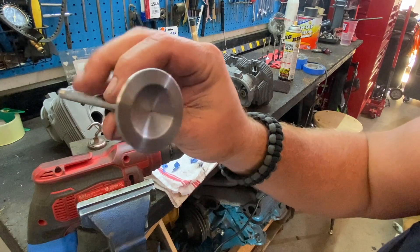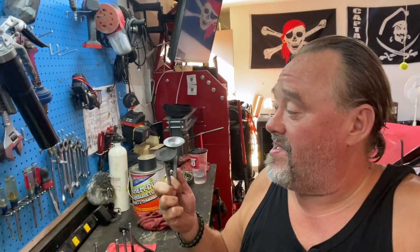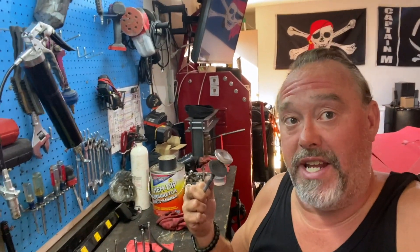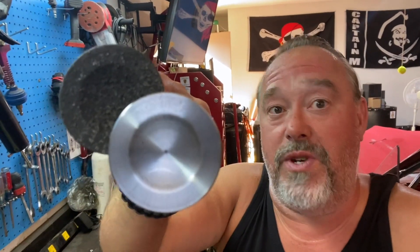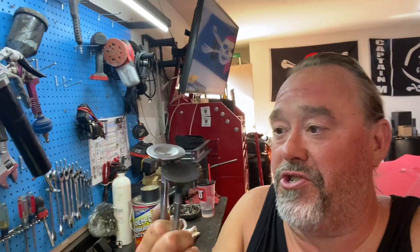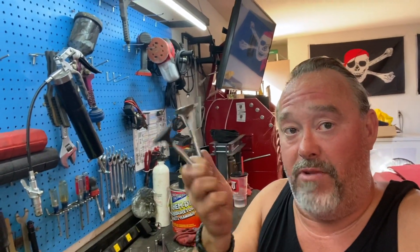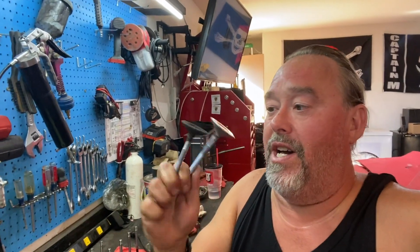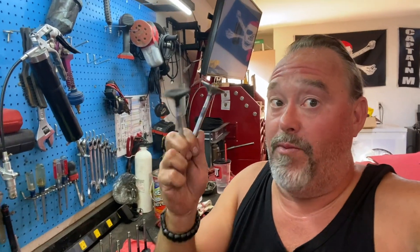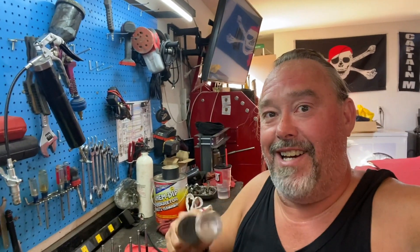That is how you clean valves on an engine. If you're rebuilding a motor and don't want to buy new valves because they're not bent or damaged, this is the way to handle it. This is how I clean the valves in my Porsche motors, and eventually I'll be working on these Pontiac motors - I've got that '67 back there and we're building a 400 for her. Check out the difference just doing this little thing. You get your scotch-brite pads, a little WD-40 or PB Blaster, spend some time, and you get your stuff looking practically brand new before putting the heads back together. If you like this video, hit that like button. If you're not a subscriber and want to see more about rebuilding Porsche motors or just rebuilding motors in your two-car garage at home, hit that subscribe button. Next we're lapping the valves to the head, then putting in the valves, springs, and keepers, and eventually putting the head on our '67 Porsche. Stick around and we'll see you next time at Arrowhead Garage!